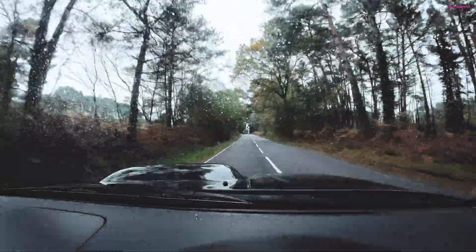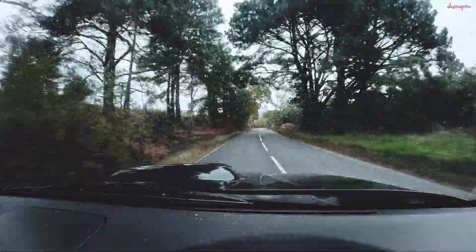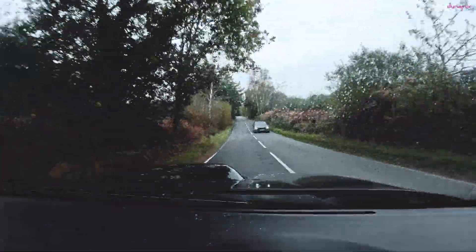After 200 miles I changed the oil — dropped the oil and put some new low-quality oil in. That sounds a bit weird, but semi-synthetic 10w40, the cheapest possible oil you could get from your local motor factors. I changed the oil at 200 miles, checked for leaks obviously, and then another lot of the same oil, which I'm going to run for the next 800 miles. I'm already feeling, at just under 600 miles, that the engine is starting to loosen up — the piston rings aren't quite as tight in the bores as they were, so it's kind of freeing itself up. I can feel that when I'm driving it, and it feels like it really wants to go.